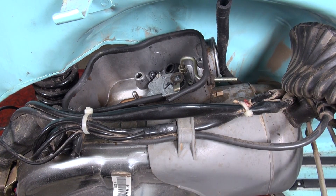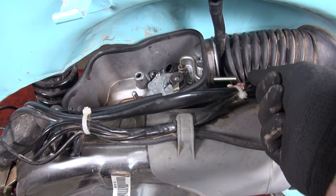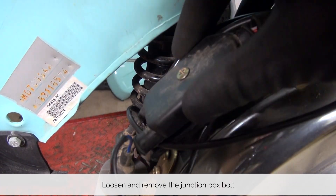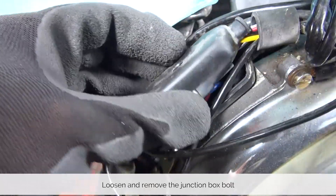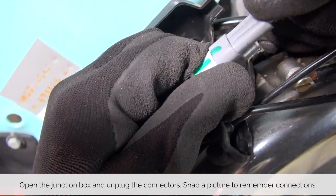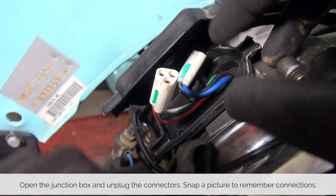With the wiring unhooked, let's focus on the wiring that goes towards the engine. This is a 2008 LML motor. The wiring on your bike might be different. Either way, we're going to start off by removing the bolt of the junction box. Open it and reveal the connections. In this case we can simply unplug them — if they are screwed together or something, don't forget to snap a picture so you know how they go back together.